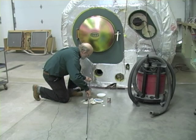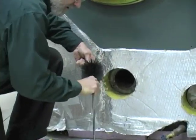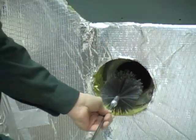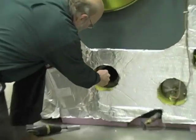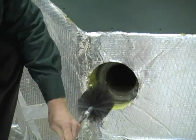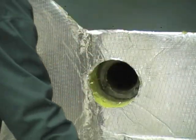Make sure that each of these rod sections is well screwed together. The last thing you want is something breaking or coming loose while you're inside cleaning the unit. Never turn these rods counter-clockwise because there's a chance you could unscrew the brush and leave it in there. Once you've got it all assembled it pushes in quite easily — just push it straight back the whole distance. You'll feel the resistance at the end, then pull it out. That's all there is to it. You can go back through a couple times. Again, wear a mask, and if you run the blower motor that'll keep all the dust and particulate matter out of the space.